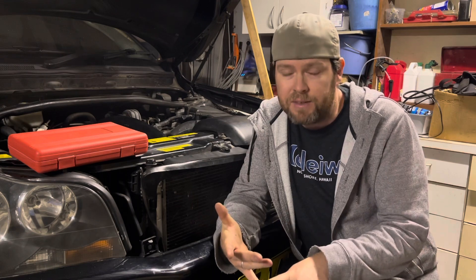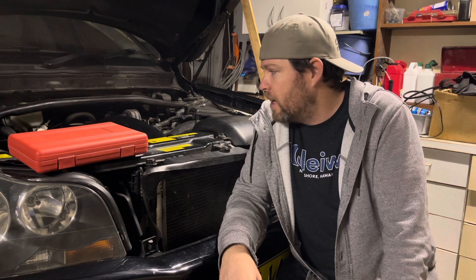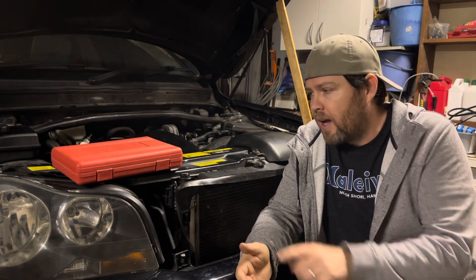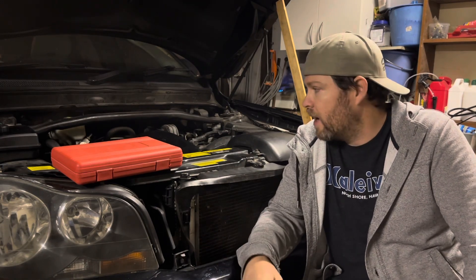So what does that mean for the poor old girl? Well, it means she's got pretty bad internal problems. It could be a couple of different things — it could be a really bad head gasket, or it could be a bad bent valve. Whatever it is, cylinder 3 is not getting any compression at all — not even a little bit. It's definitely beyond the scope of my skills and beyond the scope of this channel. But hey, at least we've got a confirmed diagnosis for not much money — probably less than a hundred dollars including products and even buying the compression kit. That's a lot less than it would have cost to take it to a mechanic.